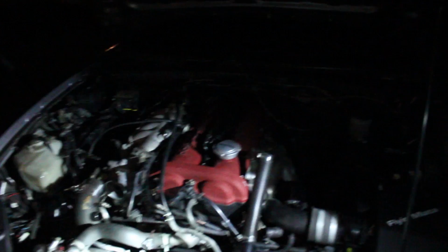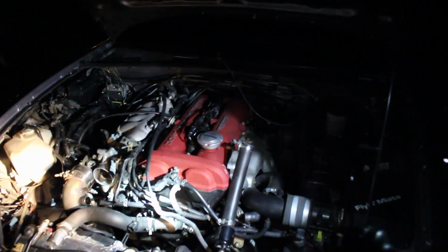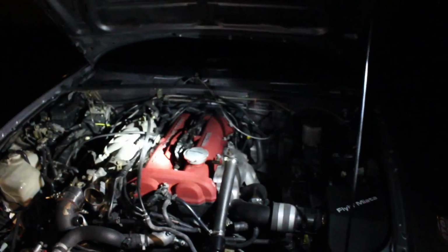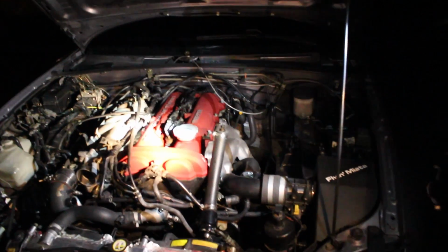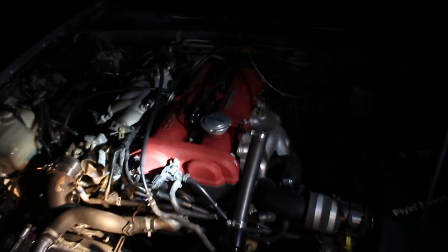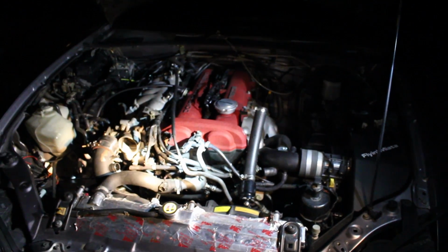We out here, pretty much just buttoning everything back up now. We're getting ready to, can you light up the engine please? Thank you. We're getting ready to hopefully crank this thing up on the new injectors and take it out, but we still don't have the EBC solenoid hooked up. Mazdaspeeds have a factory boost control solenoid, but it can't control boost, so it's pretty useless and it needs a new one. So if I have enough patience, we'll get that installed too.